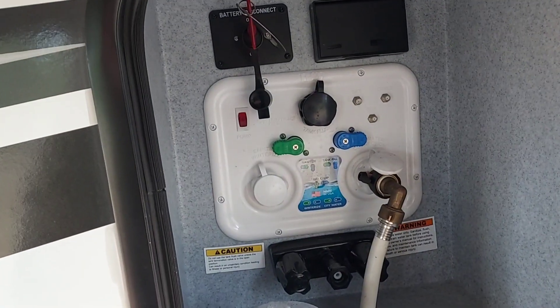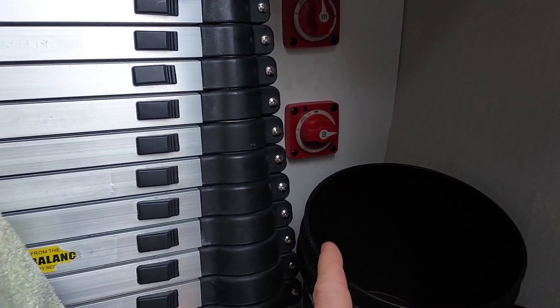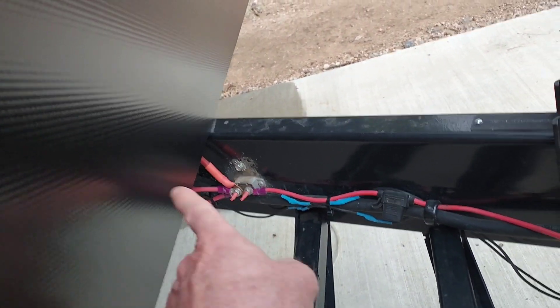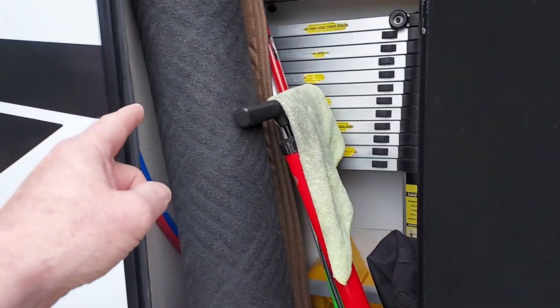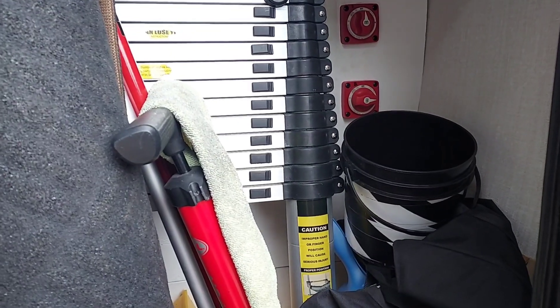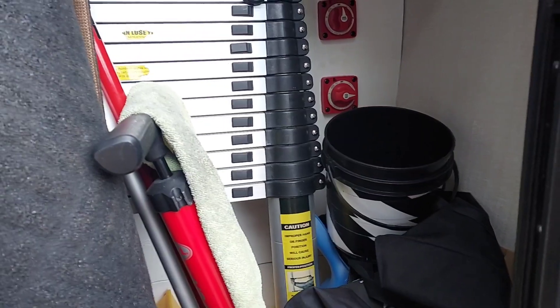Here's my original battery cutoff switch which I don't need now. This new cutoff switch here will cut off everything. That runs down underneath my trailer all the way over to the original battery connection, and then it goes back from there to that switch, and from that switch it came all the way into the control panel. I was measuring all that up and it was close to 20 feet of wire — now we're going from 20 feet down to four, so we'll cut the voltage drop significantly.